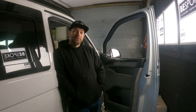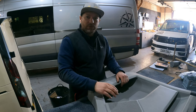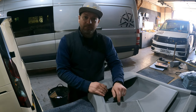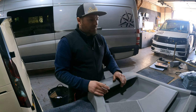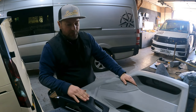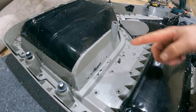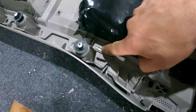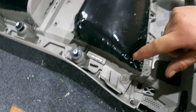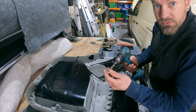Let's get started. So we've got the door card off and what we're going to do is look to remove the pocket inserts. Sadly the actual speaker cover part doesn't come off, but the handle and the top gray section — the darker gray section at the top — they do remove. There are plastic welds all the way around the pocket, along with a few of these type of plastic welds, so we're going to have to grind them off and remove them.